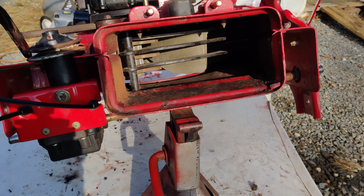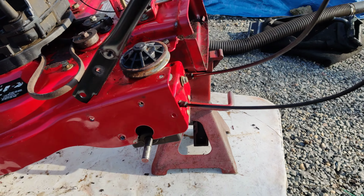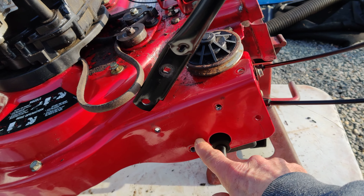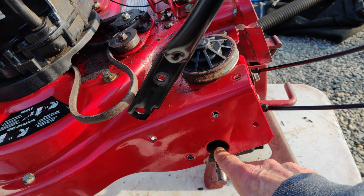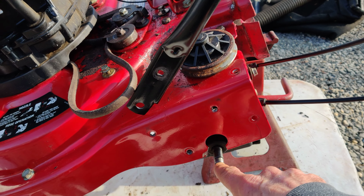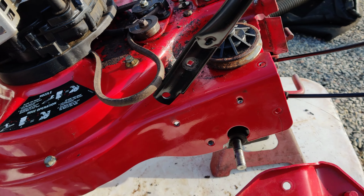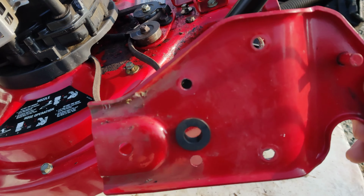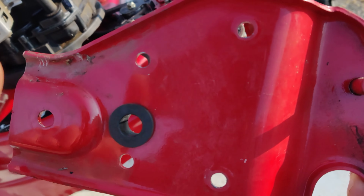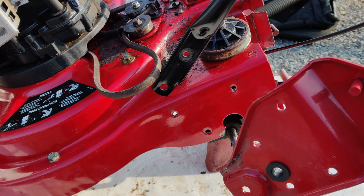And also with the transmission here, I'm able to put the transmission back up, but this was just not notched out. I notched it out so you could drop the transmission down. I know it's not going to ruin the integrity of the chassis, because this has a bushing here that slides over the axle. So this way the axle's not going to walk around or anything like that.